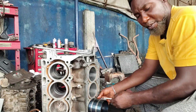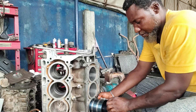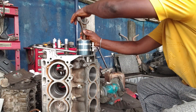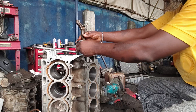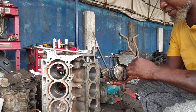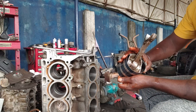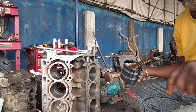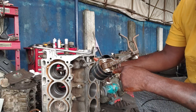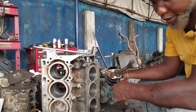I'm coming — you might not be seeing it clearly. I take it out like this; I have to make sure the rings are intact before locking it, because at times if the ring is not well intact — you have to check your rings from here. Make sure it's intact, especially the oil ring. It might pull out and before you know it, it will squeeze and burn inside the block engine.